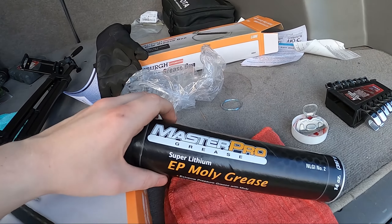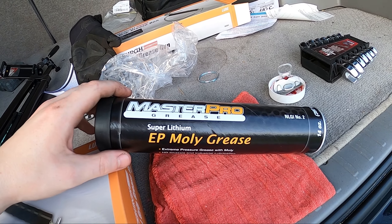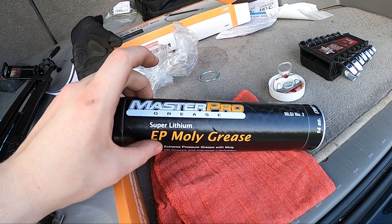You're going to need two types of grease. One, you're going to need a lithium NLGI number two — it's like the Lucas Red and Tacky. That'll be on the spider joints. And on the main driveshaft you're going to need a lithium NLGI number two moly grease, which looks like this. This is the one that goes on the main part of the driveshaft, which I'll show you.